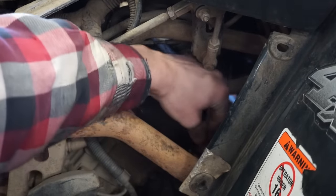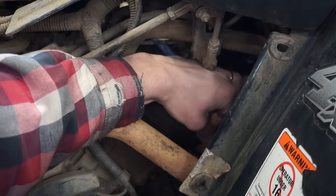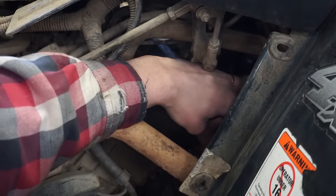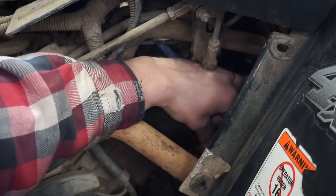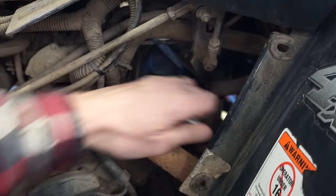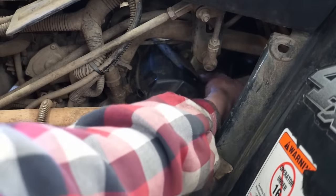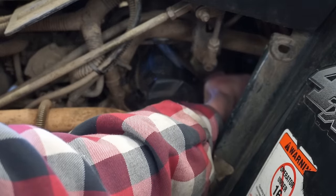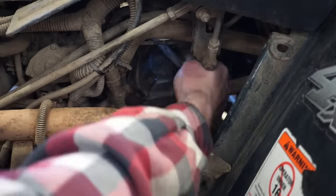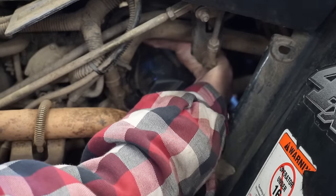Well, if it's just the valves, then I'll probably contact the guy and say don't go to those mechanics anymore, because they just scam the guy pretty much. But definitely could be low compression, because there was a bunch of dirt getting sucked in, it looked like, from the air filter. Oh, this one's a tough one. I can barely reach it.